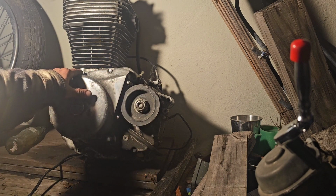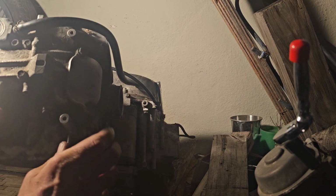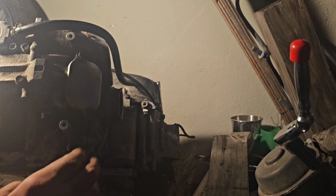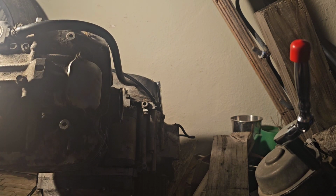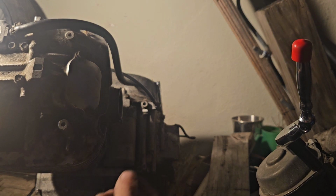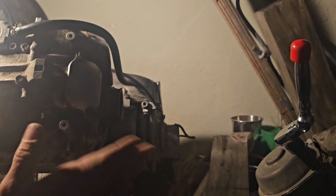We're going to round some of this stuff off, and we're going to play around with some of the stuff up here, maybe on here. These are M10s of some sort, but we're going to play around with inserting helicals. We're going to even take one of the bolts out, run it in purposely crooked. We're going to retap it, helical it, see how we fix these problems. But that's going to be at a later time.